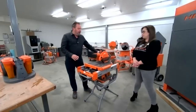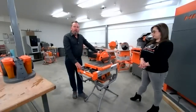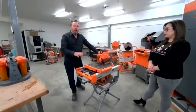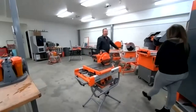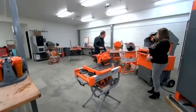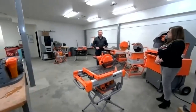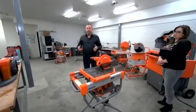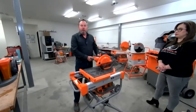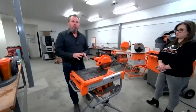In a general sense, all the tools are the same. We're going to use the IQTS 244, our tile saw, and talk around it. But these same principles apply to the 360XR or the XT, and we'll talk about the difference of those two, and also the IQ362. Primarily, you're going to want to change the filter, change the brushes on the motor, and change the louvers. Those are really the three main things.